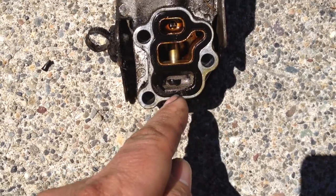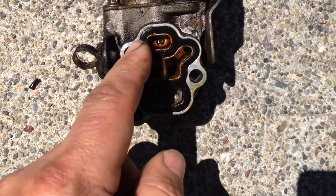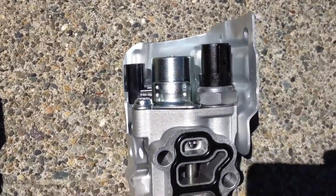Let's pray. Okay, the first thing I noticed with the new VTEC solenoid in is that it has a lot more pickup than it had before. When the VTEC solenoid was leaking, which I know it was, because it had a crack in the very bottom of its gasket. I mean, the Element's still pretty slow. But I think it's probably at least a third faster than it was. Anyways, that was the first ride of the Honda Element.